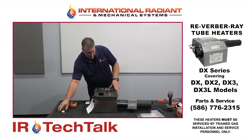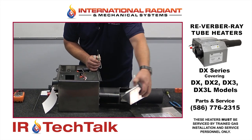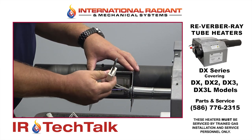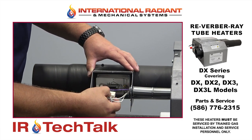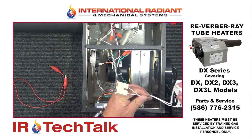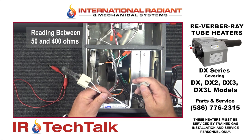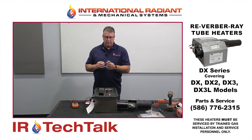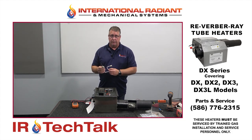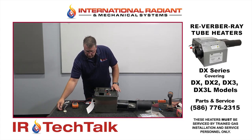Now let's say you've done that and you still have no glow bar, no hot surface igniter. Here's what the hot surface igniter looks like — I can pop this little lid off here. One convenient feature with this model is it uses a spring clip; you just take that spring clip off, the igniter slides out, the new one slides in, and away you go. You could take an ohm meter and check the ohm reading across these terminals here. If you have between 50 and 400 ohms, chances are this is a good igniter. Sometimes if you take the igniter out you could see a crack or a burn mark in it, which will tell you that could be your culprit.